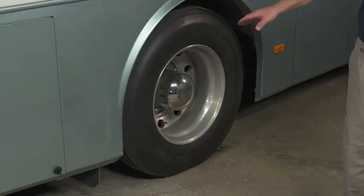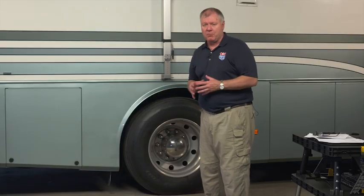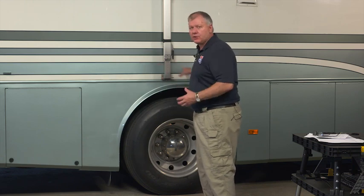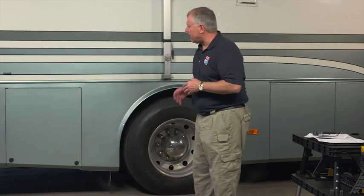If they don't hold air, I would replace them. He also mentioned that he had airbags on the back side. The airbags on the back would have probably been optional airbags from either 3T or possibly Jet Company out of Humboldt. If those airbags are not holding air, I would replace them. The next thing I would look at is the shocks, in the front especially. If those shocks are starting to get weak or starting to bend, I may even upgrade those to Bilstein shocks — the newer models that are out today.